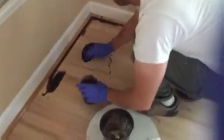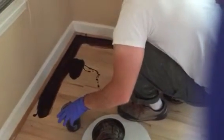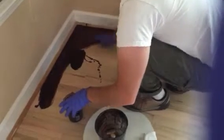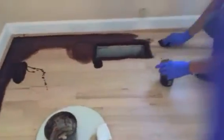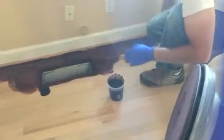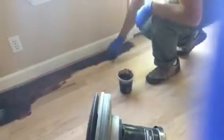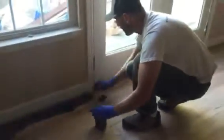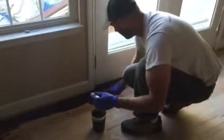Now when I rub this on, I cut in except for the corners — and this is water popped, I know that you guys want to pop. The corners I'll have my guys wipe out the excess, but the edges I leave it heavy like that, because when I'm buffing, the buffer pad will actually pick up the excess and use it. Whereas when you're doing it by hand, you wipe off that excess with your wipe-off rag and then it just goes into the rag and doesn't get used for anything — it's just waste.